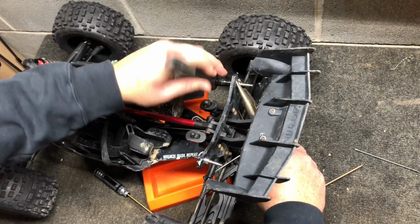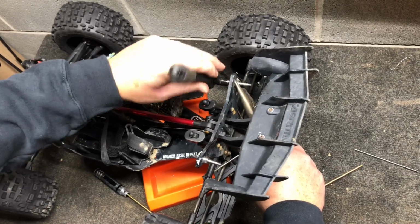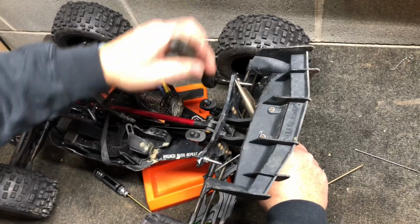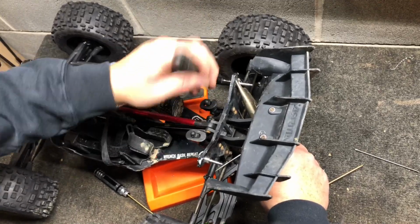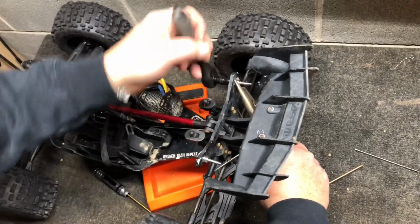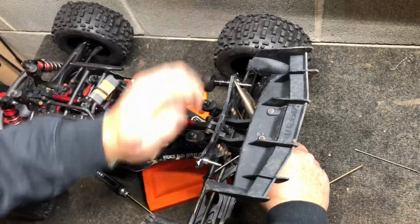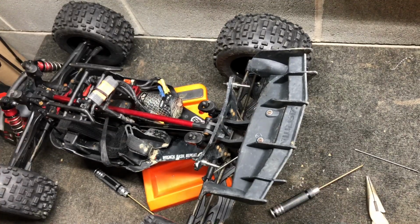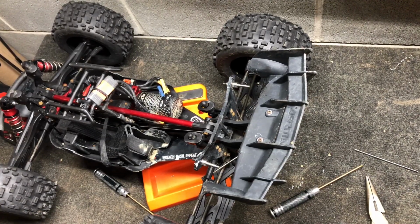It's a nice little upgrade. Tighten everything back up again, and you don't have all that slop in the shocks and all those bushings. So not a bad little thing to do. It's pretty cheap, a nice little upgrade to the cars. So I'm gonna get this one tightened up here, and go ahead and get the shocks back on, and we'll be done with the shock standoffs. But I'll bring you guys back when I get to the front Delrin cups, or the front pillow ball cups.